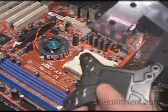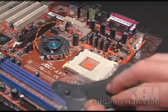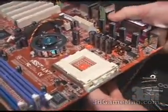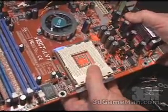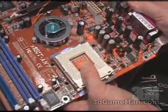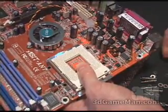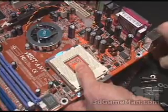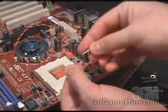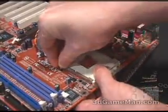Next, place the x-plate on the back of the motherboard with the clear plastic protective sheet between the x-plate and the motherboard. Carefully place this on the bottom and align it so the holes on the motherboard line up with the ones on the x-plate. Then take the four standoffs, slip a large plastic washer down over each standoff, and screw each standoff through the motherboard down into the x-plate.